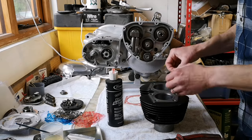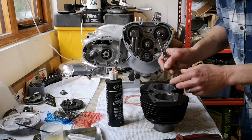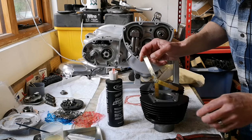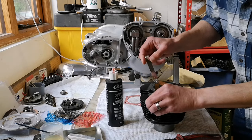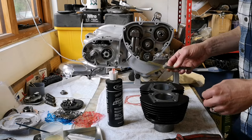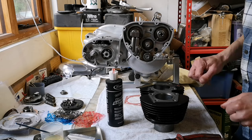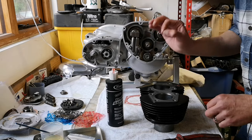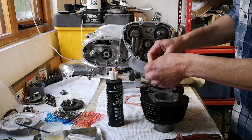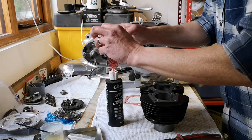both ends of the barrel. And then it's got to be between 8 and 10 thou, right? So 8 thou feeler gauge. Oh, look at that. 8 thou feeler gauge, straight in, absolutely bang on. Well, that's a sign of good machining, which means Pat Seeger has done my barrels, bored them and honed them absolutely spot on at 8 thou, which is the lower limit. Fantastic. And the rings from Harris are very, very good and accurate.